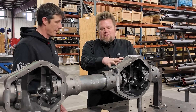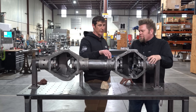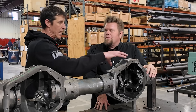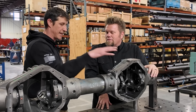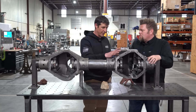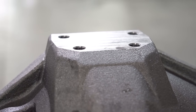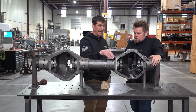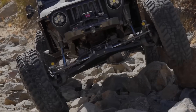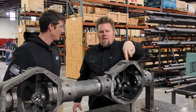You're not just buying this center for the extra ground clearance — there are other things. We always noticed that when building a 14-bolt for a buggy and putting a truss on it, the truss often ends up getting welded to the casting. Even though you're tied into the tube, that truss will flex over time and crack your welds across the casting. So we put bosses in here and here so you can actually bolt the truss to it, or bolt little plates in. When you put your truss on, you have tie-in locations to keep it from flexing, and it also ties tube to center casting even more. The bolt-in gives it an anchor, and then you just weld it in place.